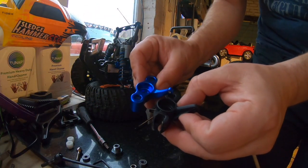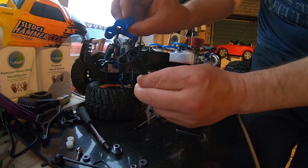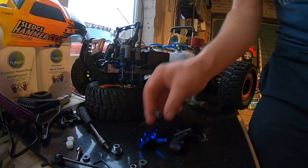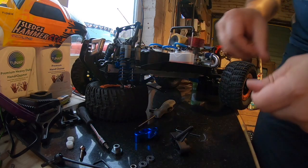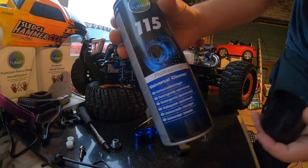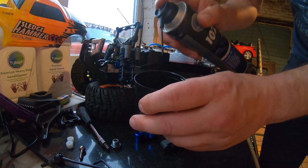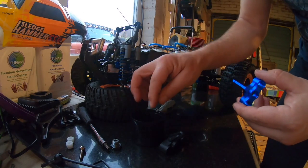When you compare the old hub to the new one — which I hope fits by the way — that hole does look a little bit smaller, but it's thicker, so I think we're going to be okay. Anyway, while these bearings are out, they feel fine actually — they've not had much use — but I'll stick them in the tub and give them a quick spray with a bit of brake cleaner, then spray them with some active oil just to keep the bearings lubricated.